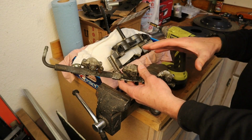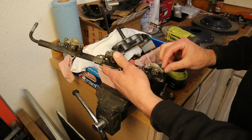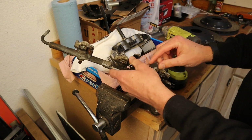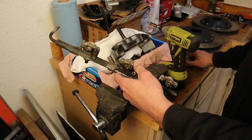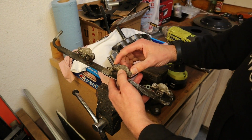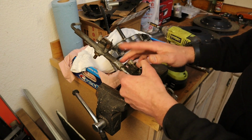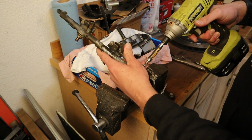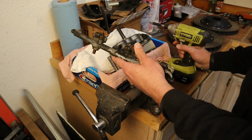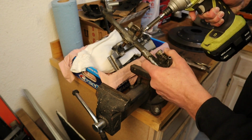All right, to start, what we want to do is take, of course, the injectors off, and some of these will probably come loose, some will not. So we'll have to use one of our extraction tools. And we're going to be replacing these with some Allen key bolts, so we're not too concerned about saving them. So just going to go ahead and try. I know this one is loose, and remove all the screws. And it looks like I'm going to have to use a vice grip.